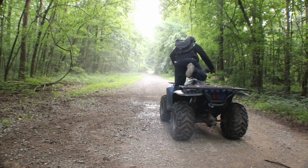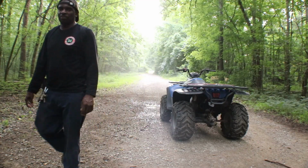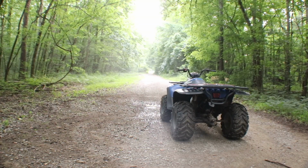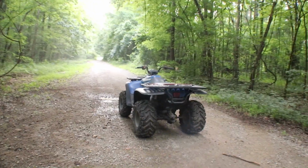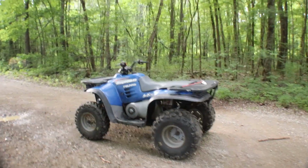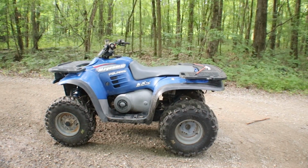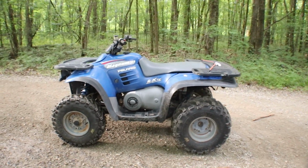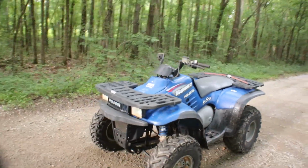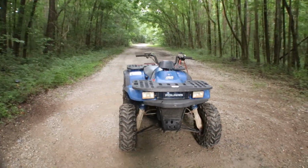That carburetor is really acting up. So I'm gonna have to do something with that carb because it's just starting to load up real bad. I mean, it don't get to moving to half throttle and it's just choking. So it might have got some trash in it. I got a new fuel filter on it, but that don't mean nothing. So I'm probably just gonna load it back up, take it back, play with it, get the carb right, and then put it up for sale.